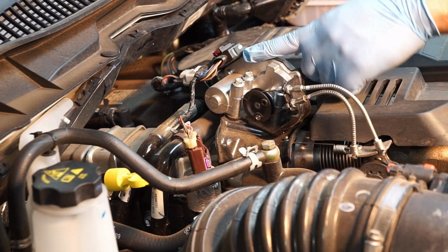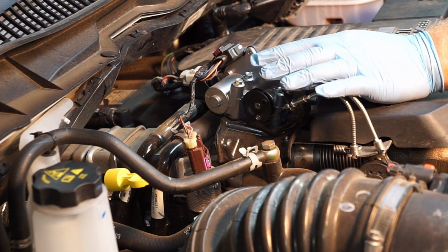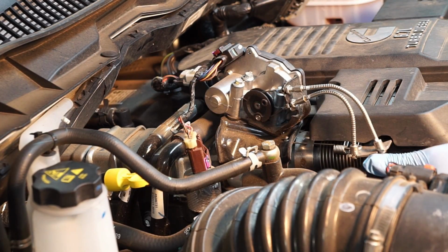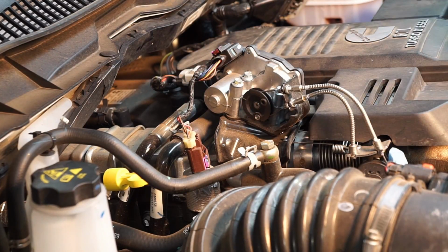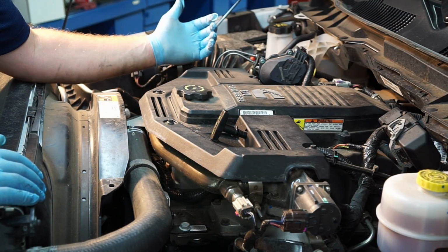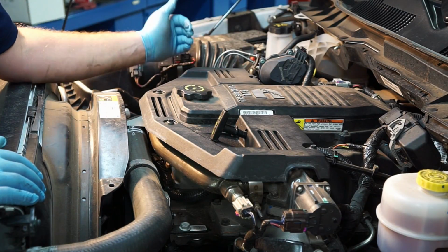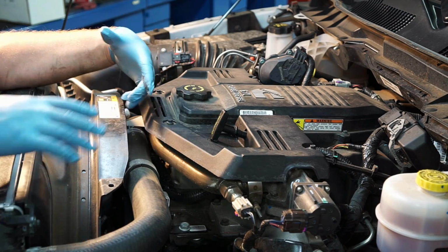On the side here, we've got the EGR bypass solenoid and control assembly. What this is going to do is a series of cables, goes over to the side here, and it's got a valve internally here. And so during events like regen, we don't want those extremely high gas temperatures to go through the EGR valve. And so now it's going to block this off. It's going to plug off the EGR flow there and help protect the intake system here.